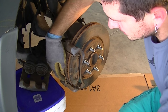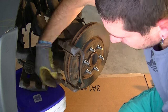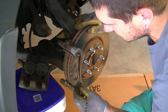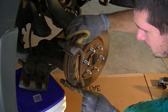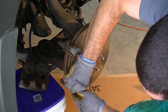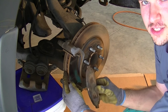Start by removing this little clip here just by squeezing it and pulling it out. Set that aside and then keep going at the clips. To remove the actual brake pads, there's a little tab at the very bottom — you'll see it on the clip at the bottom of the bracket. Push down on that and then pull the brake pad towards you; that will pop the brake pad out. Do the same on the back to remove the back pad.